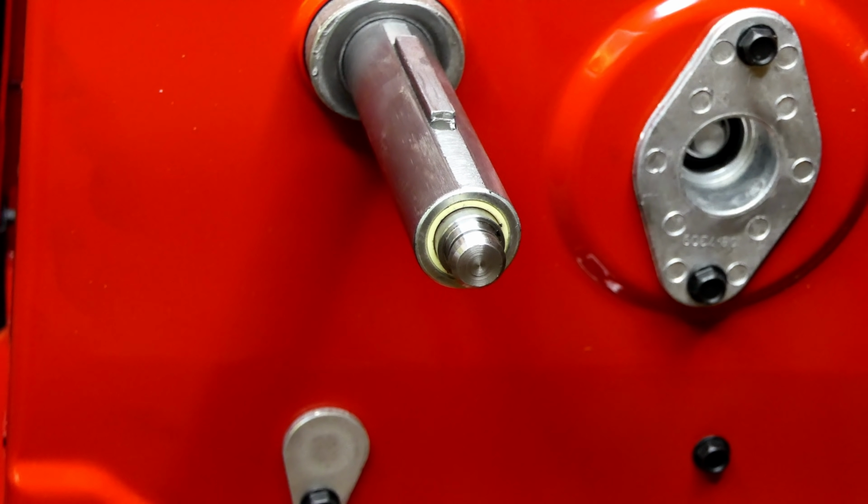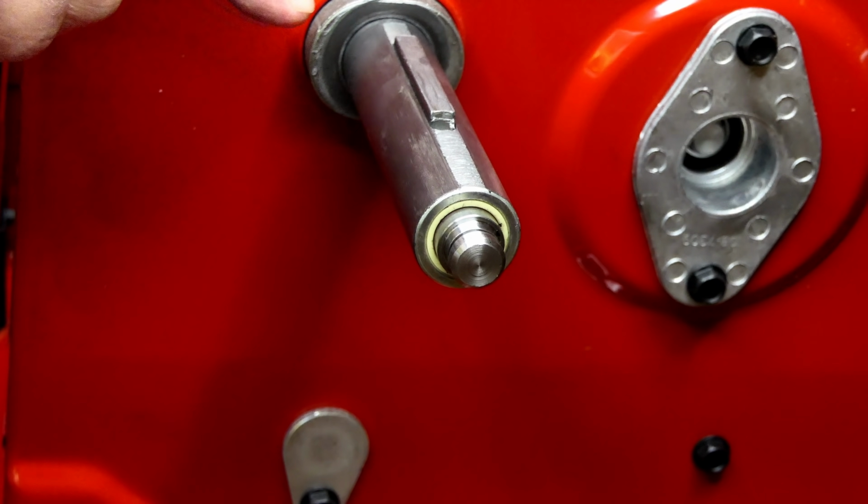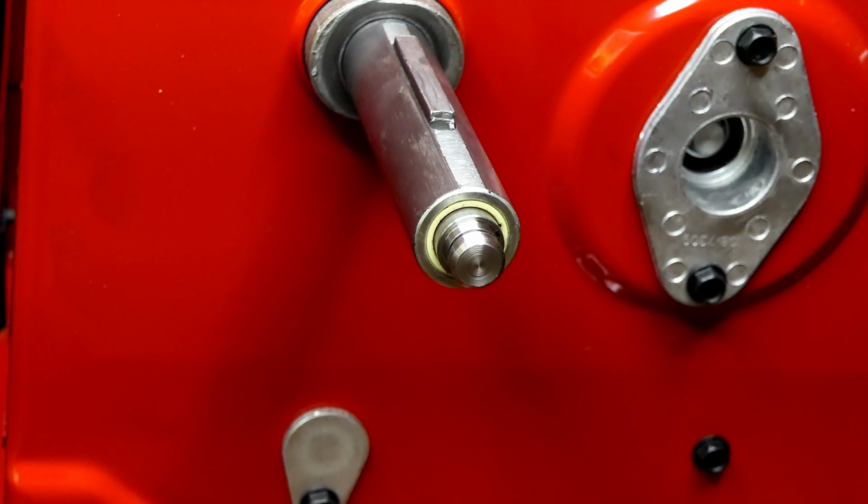I've had a few people over the years complain that they took their wheel off, put it back on, and it didn't work after that. Well, that was because this key fell out. They don't put it in the maintenance, but I would say every 3 or 4 years, if you want to, just take your wheels off and put a little grease on this, so that if you ever have to have a tire fixed or something like that, it doesn't rust up, and it's easy to take off for you. Alright, that's about it.